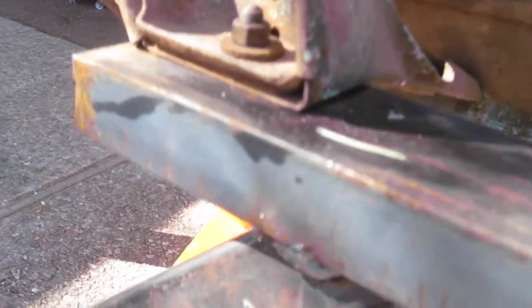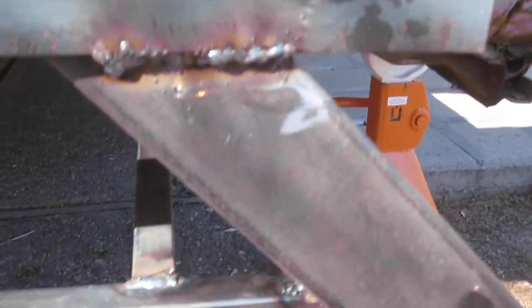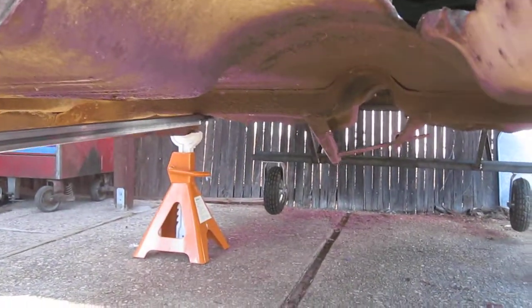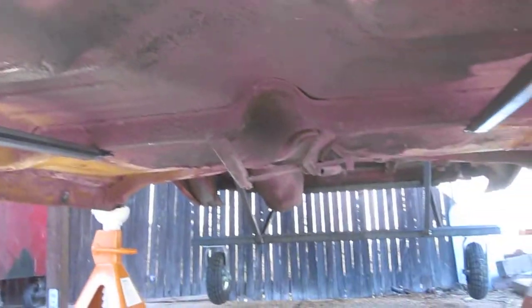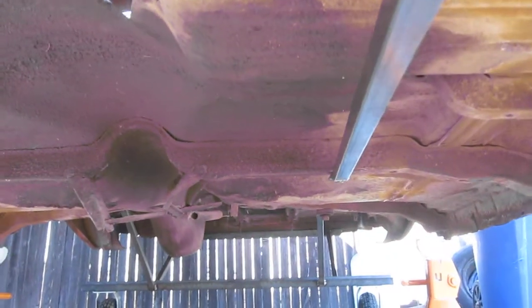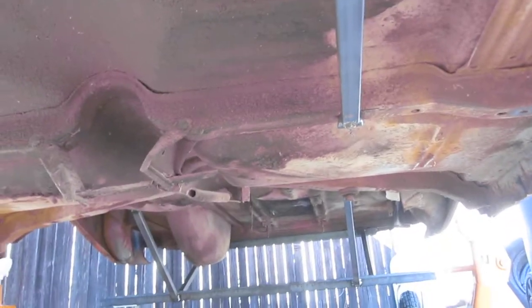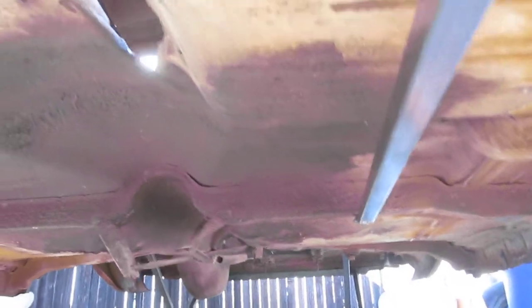You can see it's attached to the dash leg here in the front. I used some of the channel that I used to raise the car, and then there's some tubular steel — some 2x3 here, and this is 1 inch. Then it's braced to a body mount back under the car. It runs back to that body mount and is under the front seat to brace it on both sides with the 1 inch tubing.